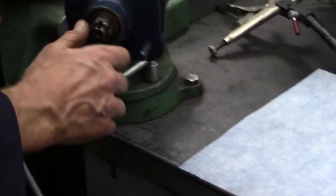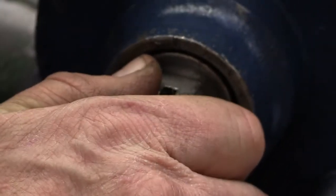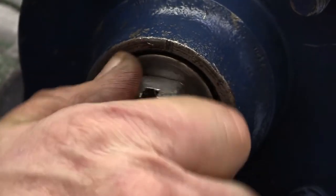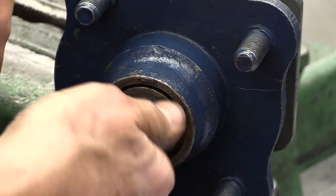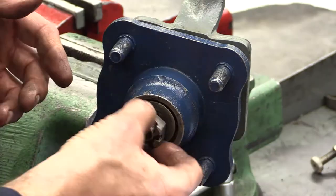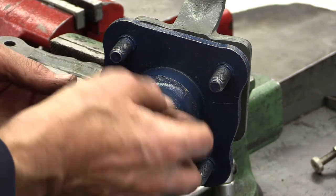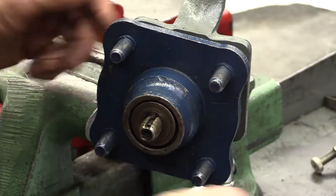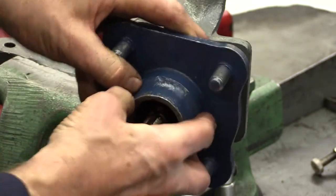This nut, by all intents and purposes, should be finger loose. It shouldn't have to be tightened, generally, but as the bearing wears you might have to just cinch it up a little. We're going to go ahead and just spin this bearing apart. If it does require pliers to break it loose, it shouldn't take very much, because these bearings are tapered roller — meaning this. I'll pull the first one out.